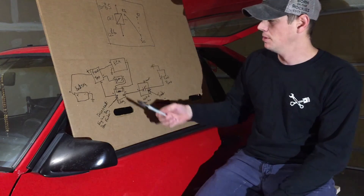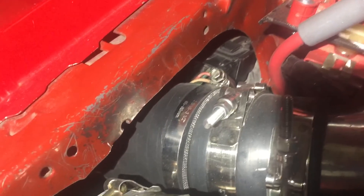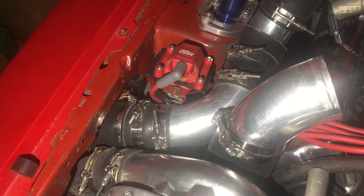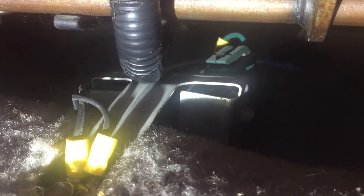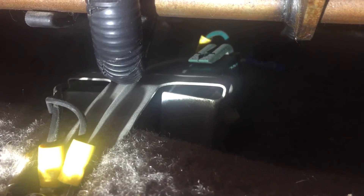Let's look at the actual components. Right down there in the engine bay is the fuel pump relay — I've relocated some things due to my supercharger, but normally it would be right below the coil on that strut tower near the intake piping. I've done a wire tuck so it's back further. The relay could also be under the driver's seat. Right underneath the driver's seat you can see mine — it's being used for something different now due to my ECU swap from a '92 harness. In that hole you can see a little white tab — that's actually the reset button on the inertia switch, located in the trunk.